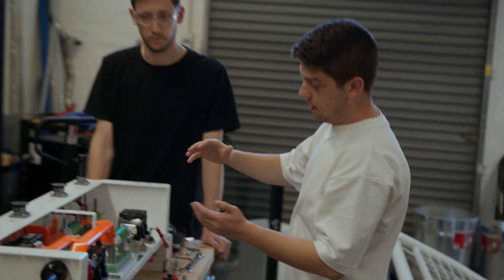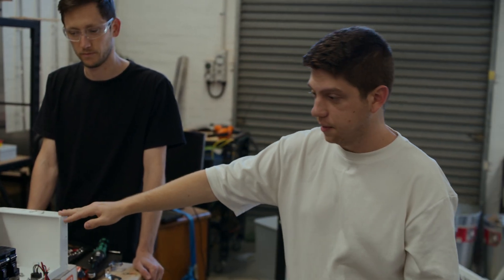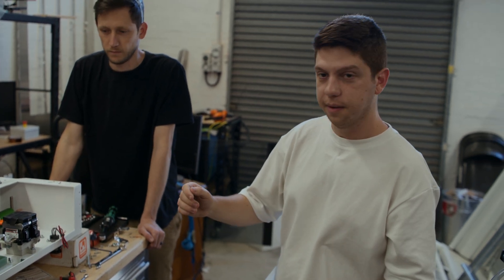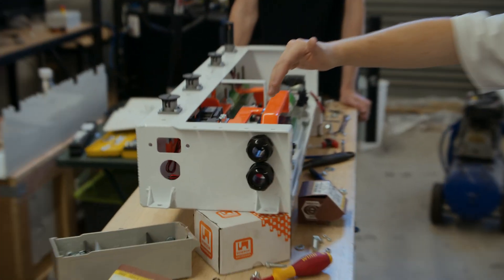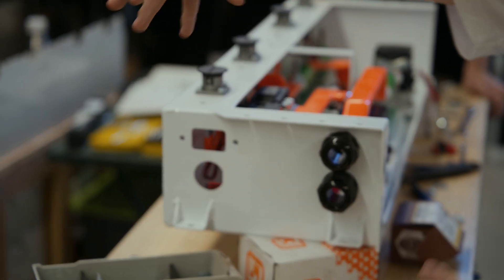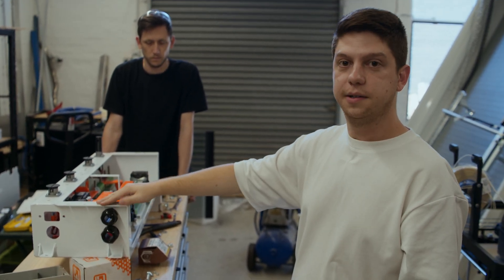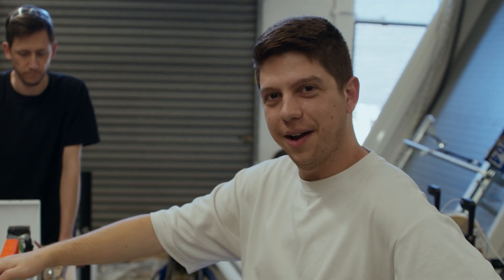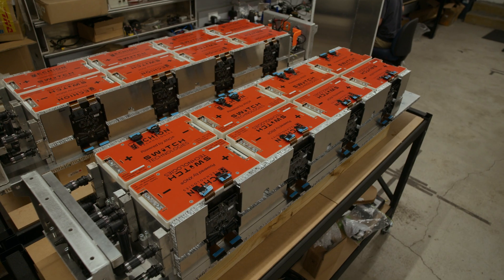More fuses in here. Another MSD — a maintenance service disconnect. The outputs of this box on the bottom go down to the motor controller. We've also got a few other smaller HV outputs. The other thing this box takes in — we've got two glands here for it — is the CCS2 charging port. That will be installed somewhere underneath the tray, cable running in, and that's how we'll charge — standard CCS2, which is what you get on all your EVs. Really excited to see this thing at a public charger. That would be hilarious having a 79 Series parked up next to all the EVs — but hey, it's a hybrid, so that should be nice and fun.